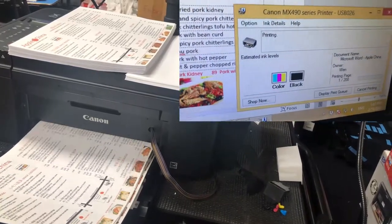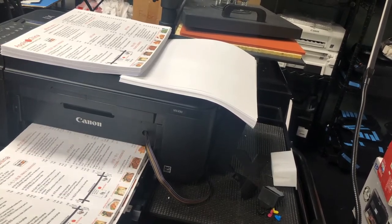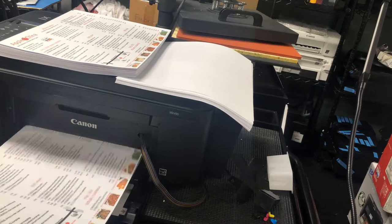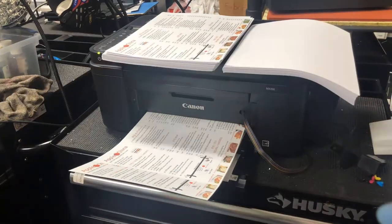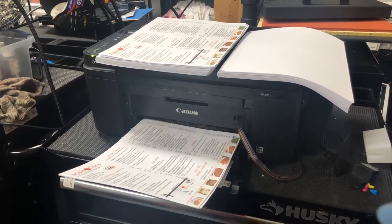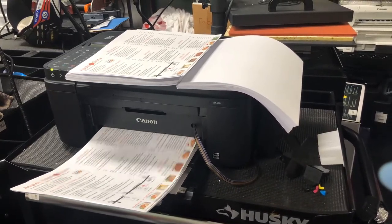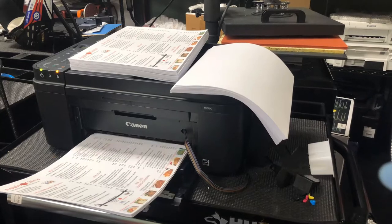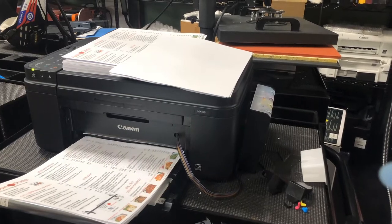You're going to see the ink level coming down. However, that's actually the printer's estimated level — the printer doesn't know how much ink is left in the cartridge, so it just counts the number of pages printed. You have a big ink tank with a tube going into the cartridge, but Canon doesn't know that. So you need to turn the ink level monitor off. However, you can only turn it off after the page counter goes to the max and the ink level shows depleted. So you need to ignore all the low ink warnings and just keep printing until you run over the limit.